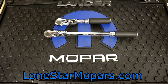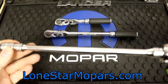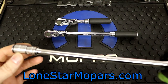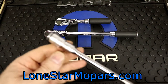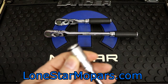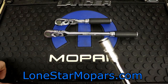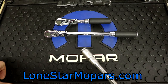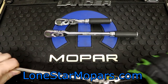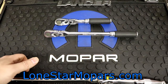It was attached to a Koken locking extension and a nut grip. Half-inch nut grip. What is it for? 5/16ths bolts. Where? Thermostat housing — the water neck on a '94-2001 5.2, 5.9 Magnum. So what does all that have to do with things? Well, that all leads up to item number one.